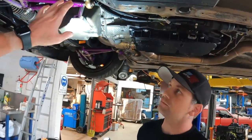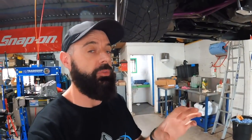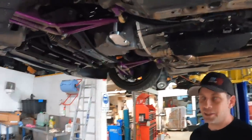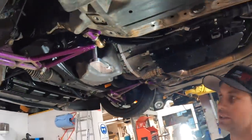There's a good use case for this beyond just Dan's car. Factory BMW race teams on some newer models are also deleting the electronic dipstick. It's about being able to check your oil in two seconds instead of two minutes when you come into the pits. If you're running a high-performance engine and changing your oil frequently, with this you don't need to run the engine — just put the correct amount of oil in and check it's set right.